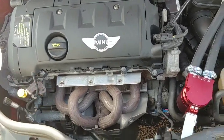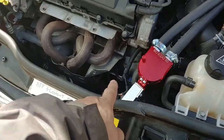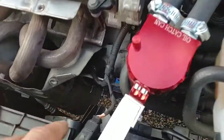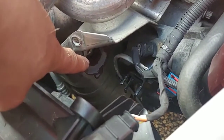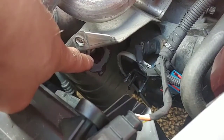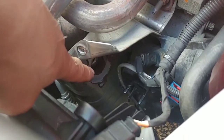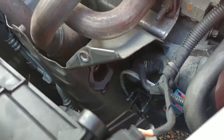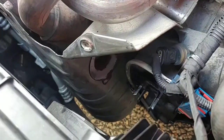Here's what I'm going to do: I took it out, I'm going to run my borescope down there — my endoscope — take a look around just to see. Then I'm going to use my power washer through the hole where the oxygen sensor goes, and while it's running I'm going to blow high pressure water through there and hopefully disturb everything on the catalyst media, declog it or break off the soot or carbon or whatever is causing the catalytic converter not to do its job. Let's do some borescope.